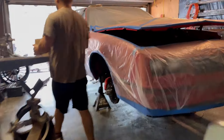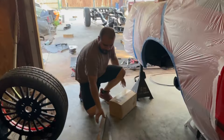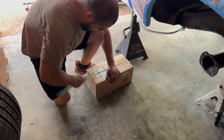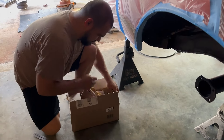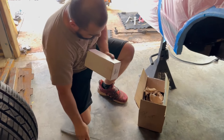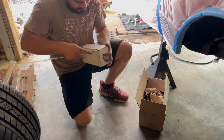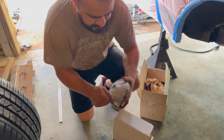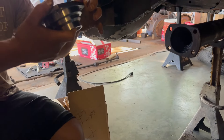Those are for the big Ford rear end — for that other truck out there. The flanges are from All-Star Performance — that's the brand I've always used. These are the flanges. They're a different bolt pattern because of the Torino application. Is that billet? It's solid. Smaller bolt pattern and a smaller bolt — that's a half-inch. So these are too big; those are the ones I'm going to put on.